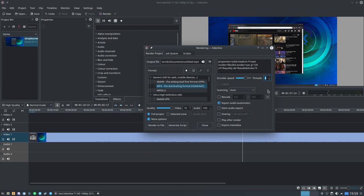Now, you can do that. The system will still work if you set your video program to use four of your four cores. You will find, however, that everything else is very sluggish. It is usable, but I would suggest that you don't give it four cores if you intend to do something else while you're rendering your videos. Perhaps give it two and retain two for something else. If you're not bothered and you just want the fastest render time, then give it all four cores, and it will still work fine. The system, the background software, is intelligent enough to know that you still need something in reserve for your system tray functions and general operation.